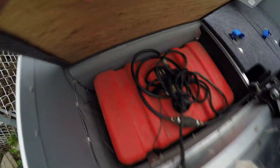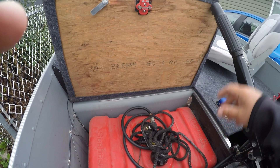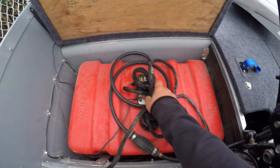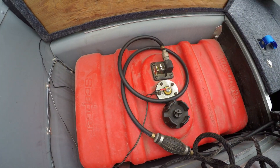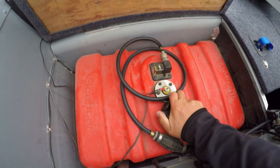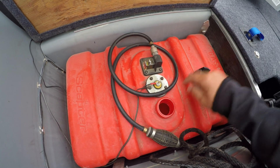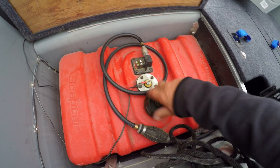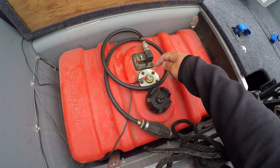At the back compartment — I actually use the motor arm as a wedge to prop the lid open. I was going to install a pneumatic jack but the arm works fine. This is an absolutely huge tank for the back of the boat and it fits perfectly. This is how I attached my sending unit — this style of gas tank didn't come with one, so I went to Princess Auto and bought the unit and installed it myself. The tank's oval opening is actually quite thick rather than thin plastic, similar to a custom Scepter tank with a built-in sending unit, so it can be modified to accept one.